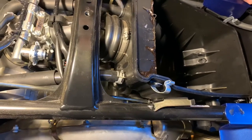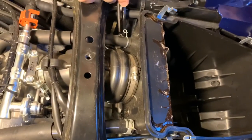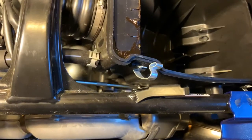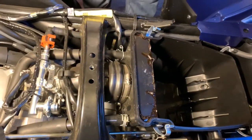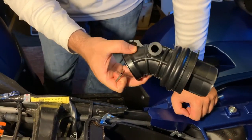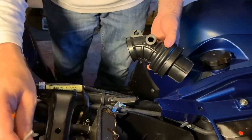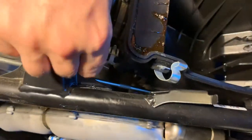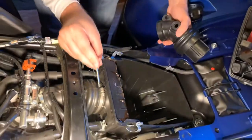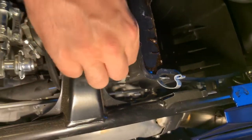Take a pair of pliers, pinch the spring clamps together, and work the AIS hose and crankcase breather hose off their nipples. There is also something up under here going into the intake boot — I can see a wire and I'm thinking, based on what I can see, this is unique to the 2019 and up models. It must be a sensor or something. It appears the air box does not use the port on it, so I'm guessing they may have relocated that sensor to the boot in 2019.